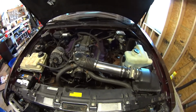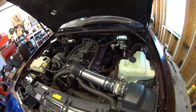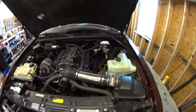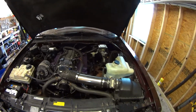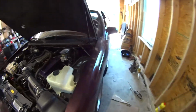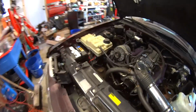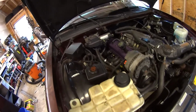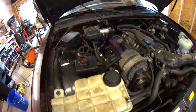I do think I have an exhaust leak, so I'm going to swap out these header gaskets. And then the new thing that sort of cropped up, which I'm really not happy about, is that I'm getting a bit of a clunk from the upper ball joints on both driver and passenger sides. I can probably replicate it for you. That's the one on the driver's side, and there is another on the passenger side. Although, this side I pumped with grease, so it's a little quieter. You can still hear it a little bit.